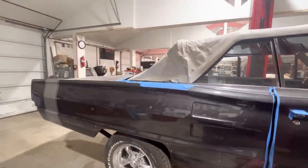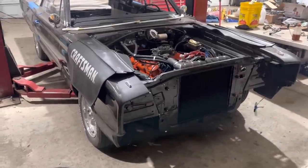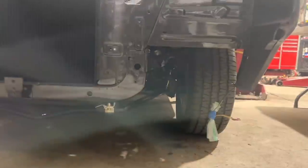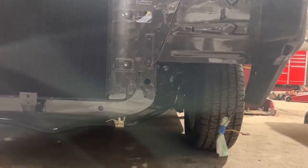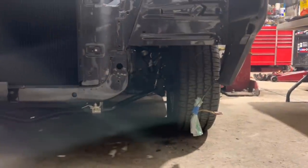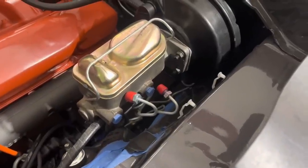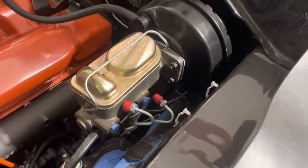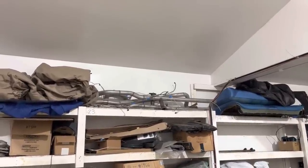A successful day of Coronet progress. All the brake lines are connected except for one — that bracket's in the car too. So much left to do, but that's future Jamie's problem. Today is several days later and I've made more progress. I've got all the brake lines connected underneath, put it back on the ground, and torqued the rear suspension and U-bolts. I've also torqued the front suspension, at least for now. I'll have to loosen the upper arms to do an alignment, and these sway links are too short — the bar is hitting the strut rod. Common problem. Going to need longer links. My next task: connect this already-bled master cylinder to the brake system, bleed it front to back, get a pedal that works, then install the exhaust. Once that's done, we'll put it back on the ground, fill it with fluids, and we might just break this thing in this week.